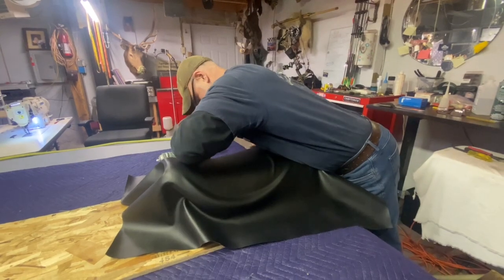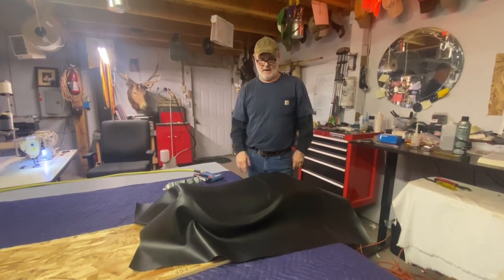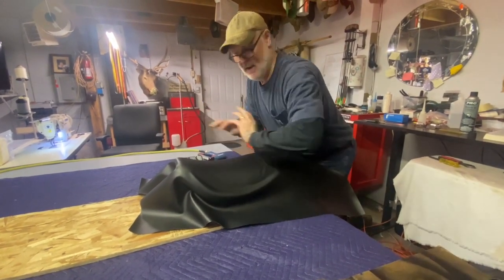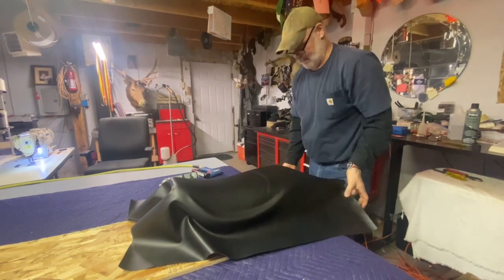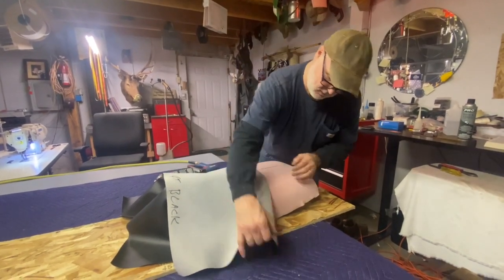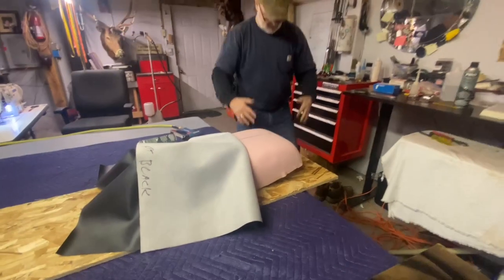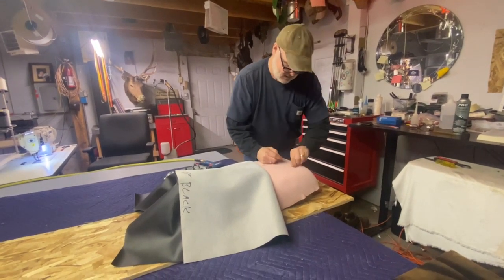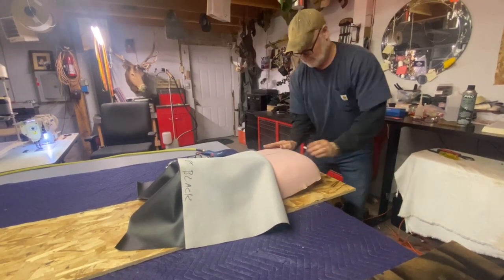Now that scrim is glued down — it's been locked in, been sitting there half an hour. Then you start this. I like to start in the front so I can push away and pull around. It's just memory. Now I pull this up — a little pop — and you see how resistance begins. That's where the glue is. We leave all this open down here — you don't want to glue that. It's just where you're sitting, where your legs are, the top and around. And then up over the butt because you have to pull that. Glue right there on that roundness.